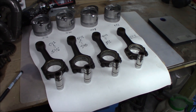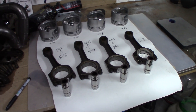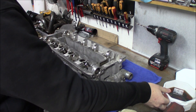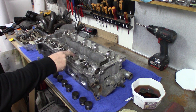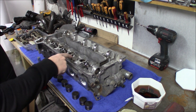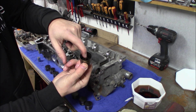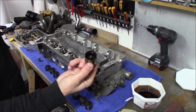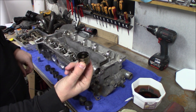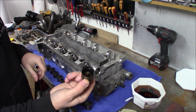Now I'm going to show you a little bit about the cylinder head that I didn't get quite right last time. In the last video I said I managed to save six of the lifters and the others were rock solid. I put one on the ground and punched it really hard and it didn't move a bit — I thought it was blown or stuck for sure. But I got a comment saying you need to press it really hard to get out the old oil, and that is perfectly correct.